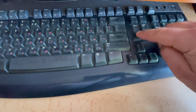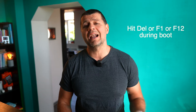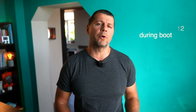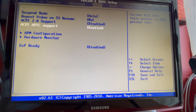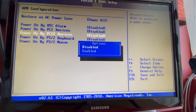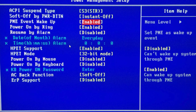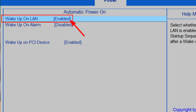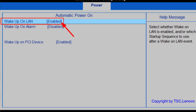Second, you may have Wake on LAN support but it can be disabled by default, so you just have to enable it before using it. Most of the time you have to enter the BIOS of your device. Usually this can be done by hitting the Del key, F12, F1, or something similar immediately after you power on your device. Once inside your BIOS, find the Wake on LAN option and enable it. Unfortunately every motherboard vendor has a different location and even different wording for that feature, so you have to search for it. There is no universal solution.